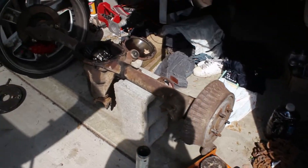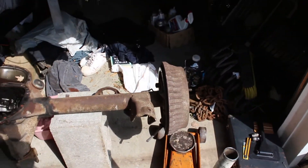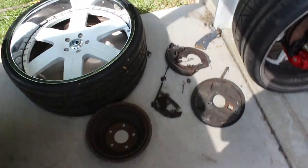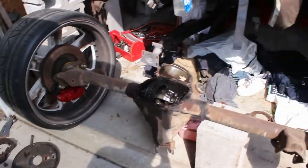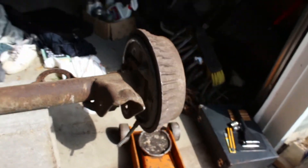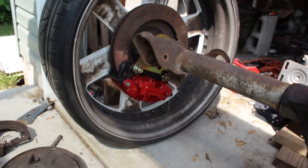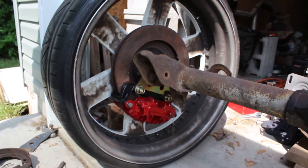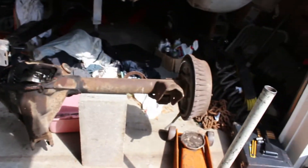What's going on YouTube - got a couple hours of free time so I'm out here messing around with this rear end again, about to break this side down, get rid of all the drums, brakes and all that stuff - the backing plate - pull the rim off, just gonna turn all this stuff off and mount the Corvette calipers and brackets along with the conversion bracket I got from online. About to get ready to pull this mess off.